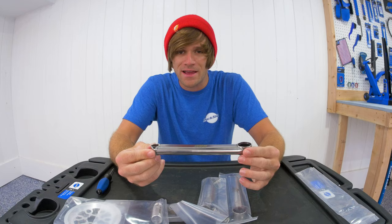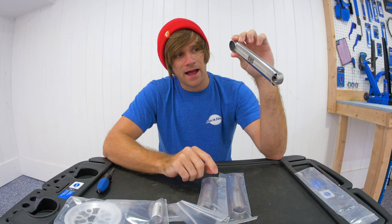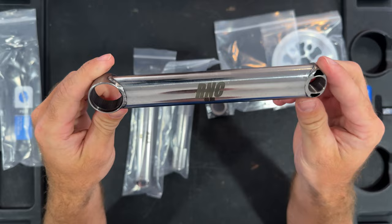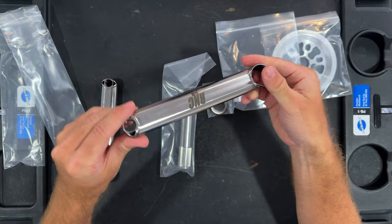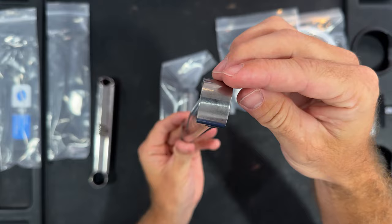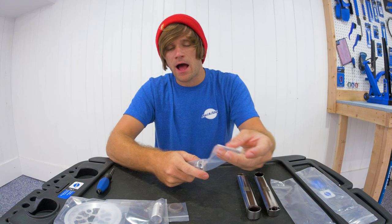These cranks are made of 300 maraging steel. I'm not going to pretend like I am a metallurgy expert, but from everything that Ryan at RNC has told me about this metal, these should in theory be the lightest and strongest cranks ever made. You can see they are indeed a tubular welded crank — there are two different welds on here. They have a very thin profile, and I have the 170 millimeter version here, with several different options available.